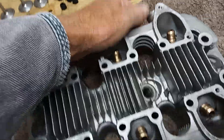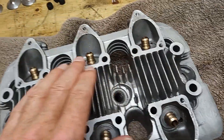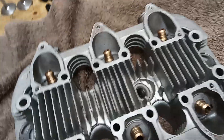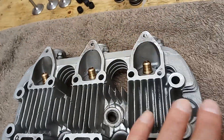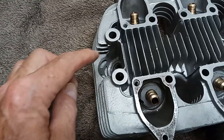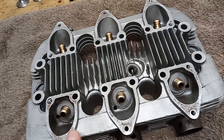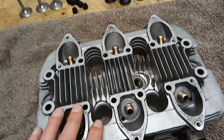Since the head came back, I've run a tap down all of the threads to check they're okay. They're all UNC quarter inch threads - one of them has a Helicoil which is fine, and the others are all okay. I've also double-checked the threads on the spark plugs because they need to be 100%. The vapor blasting can show up if there's a damaged thread, but we're all okay. Everything is now ready to start putting the valves back in.